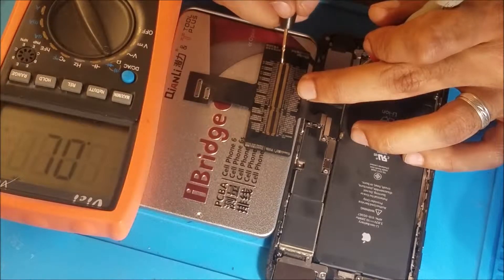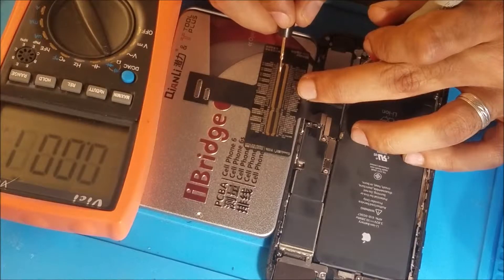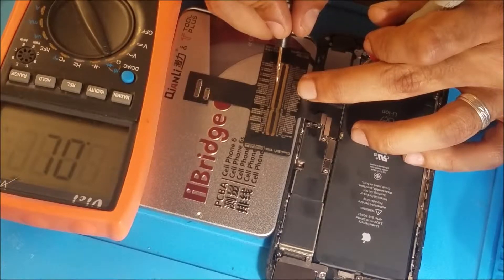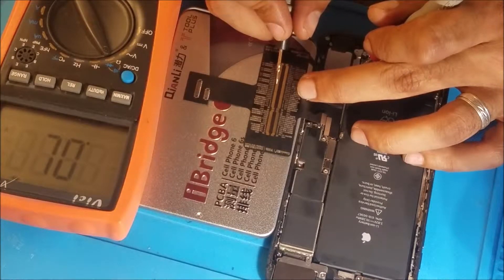We go to the other side of the connector. 478. We get just 398 — that's still OK. Next 477. Then ground — good. And 479. 478. 478. Ground. 483. 485. Ground. 485. We got nothing — we got an open line here. So this is the first issue. 485. Pin number 30 is open.